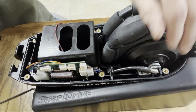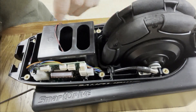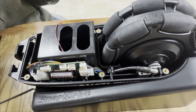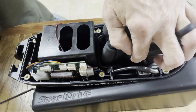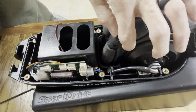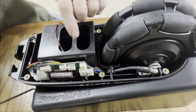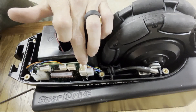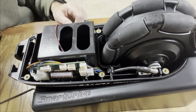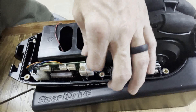This is a standard 250-watt hub drive, just like you'd find on a scooter or bicycle. You have your three-phase power coming in here. This is the hall sensor — it normally has five wires: red for power, black for ground, and then three wires for the hall sensor. The fields are on the inside of these motors and the permanent magnets go by, so the hall sensor tells the controller what position the magnets are in to achieve the correct speed and torque. This one also has an extra white wire, which is a straight-on speed hall.